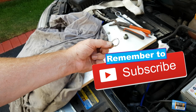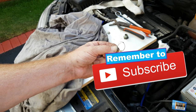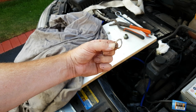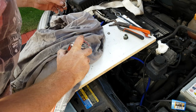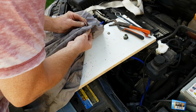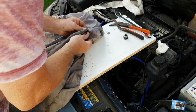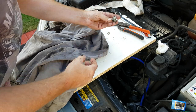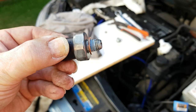When you remove the sensor and adapter from the engine, make sure you recover the sealing ring between the adapter and the block. Soak some brake cleaner in a rag and use that to clean up the sealing ring and the adapter. The sealing ring of course just goes back on there like so.